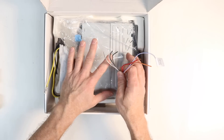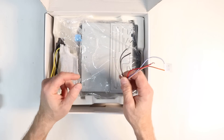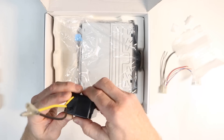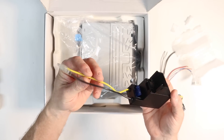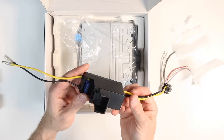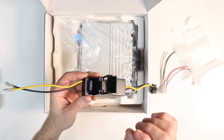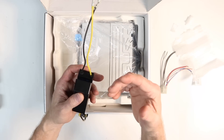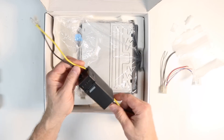The high-level input on this has 3 to 12 volts of input — there's no amplifier power in this unit. Inside the box is a second harness, which is the power supply filter as well as the constant 12 volts and ground. This needs to be connected to your battery with a 12-gauge wire. It has a 15-amp fuse, about 5 amps more than most factory systems allow for. Check your fuse box for a 10-amp fuse, and if so, run power out to the battery.